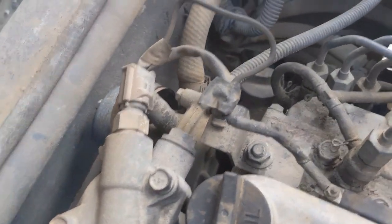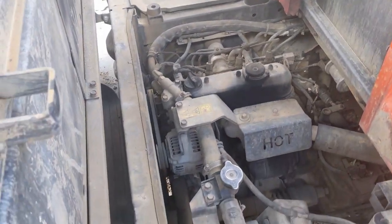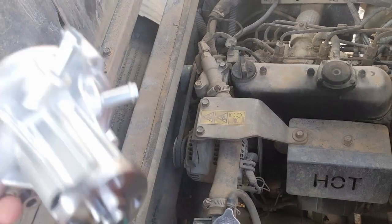So that's the water pump right here. The shaft seal on it appears to have gone out, and it's been drinking about a quart of water every half hour or so. And we don't like that very much.